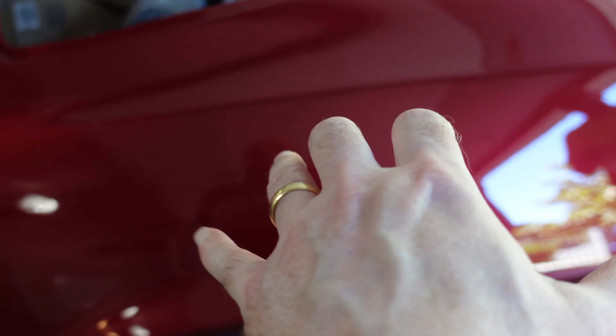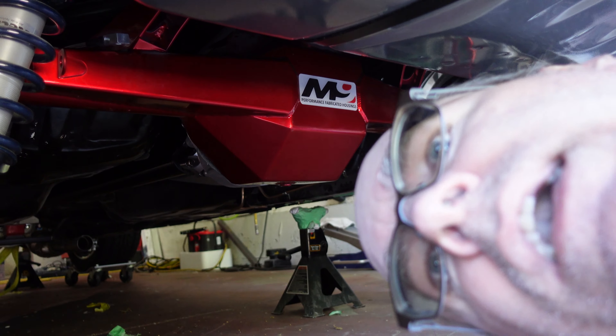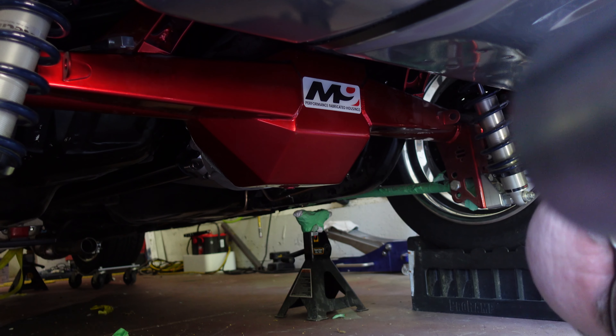The hangers that go on the car need to be installed and have some play to them, so we'll figure it out. We'll start from the middle, get to the mufflers and the X-pipe, and then from there forward we'll cut to the right length.